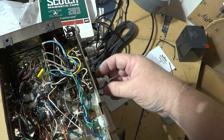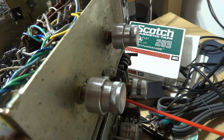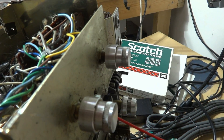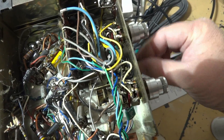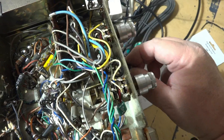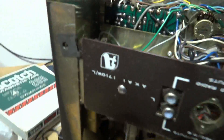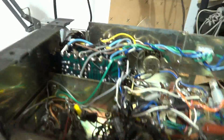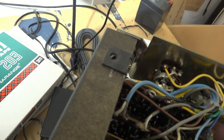That one is done. The tape mode selector switch is in the front, so I can give it a shot right through the front here. I'll move it over to get access inside the switch — that should be sufficient. Now, this switch selects the left channel, the right channel, or stereo. Somewhere in here there should be a slide switch — it's probably right in here. There are two slide switches right down there and I need to get my cleaner into those as well.